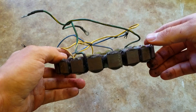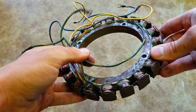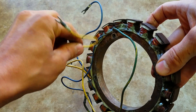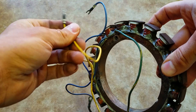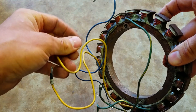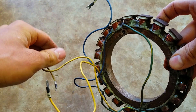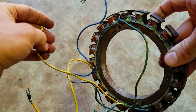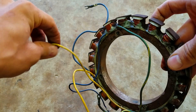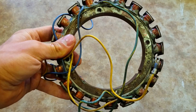Another thing to check is the wires coming out of it. You want to make sure they're not broken or the insulation isn't cracking. Something I've noticed is if you just feel them — like this one right here, it feels really rubbery and it almost feels like there isn't wire inside of it. I've noticed that bad ignition components tend to feel like that. You can see this one is a lot stiffer; this one is just like spaghetti — there's almost nothing to it. That's another thing you want to check.